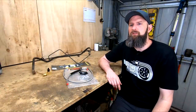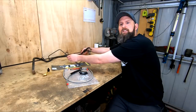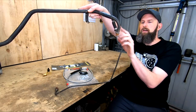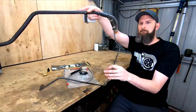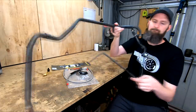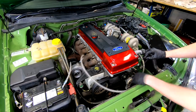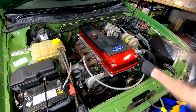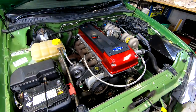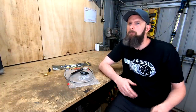You'll have already seen that I've gone with some aftermarket coolant lines, which are from Mamba on eBay. The factory turbo lines that run around the block have an extra provision for a joiner hose and hard lines, but good luck trying to find them, and if you do they look like a pain to swap over anyway. For $85 we have these braided lines, and I'm going to attach these in line with the hose running from the top of the thermostat to the overflow. Not the prettiest, but it's dead easy, gets coolant flow, and will work just fine for now.